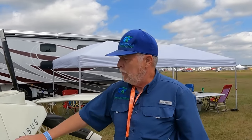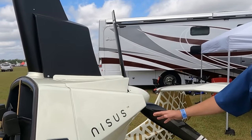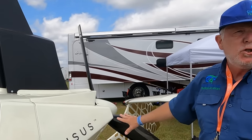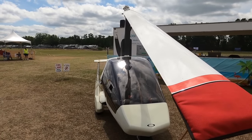This aircraft comes with multiple engine choices. You can get the whole line of Rotax choices, and they also have the Edge Performance selection — this particular aircraft has the Edge Performance 130 horsepower model. You can also get UL Power. They're also anticipating the new Rotax 916. The engine compartment is totally enclosed, with a lot of thought and engineering put into the cooling — a separate ducting system for the oil and water coolers, and a separate intake for engine cooling. On turbo models, they'll also add an intercooler, which is important because turbocharged Rotax engines run very hot.